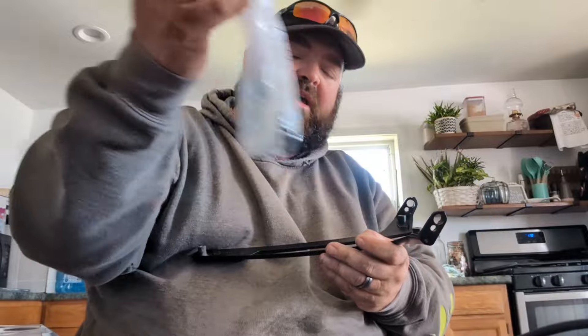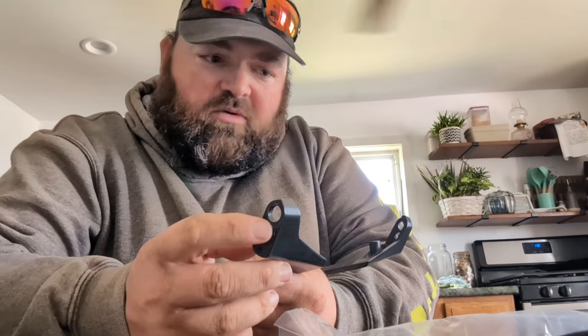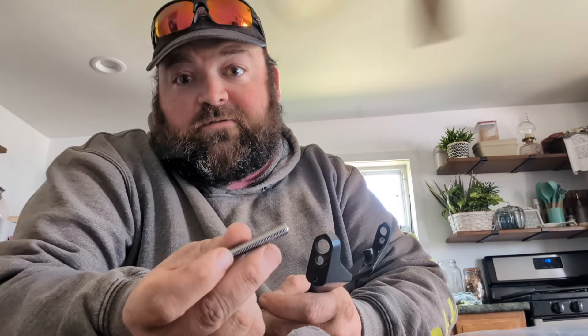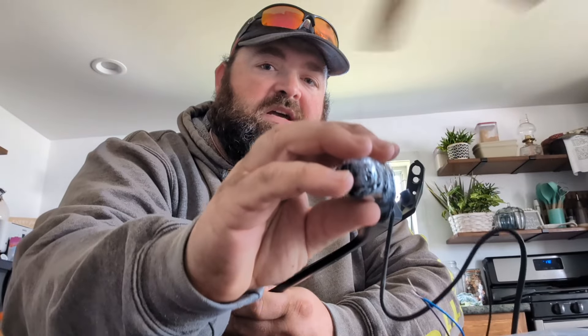Here's what we're going to do. These bolts weren't bad — we got them at Ace Hardware for like 55 cents apiece. What we're going to try to do is bevel this out to where it's just wide enough to fit this, which is 5/16ths or maybe a hairpin more so it fits. We're going to drill that, then line it up. The hole is on the far end of the light, so it needs to be technically down here — but you'll never get it there because of the clearance issue.